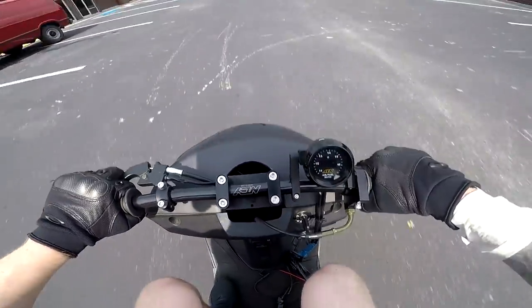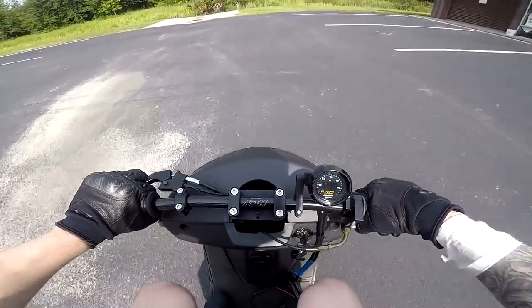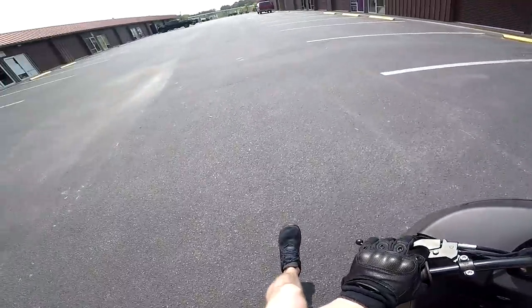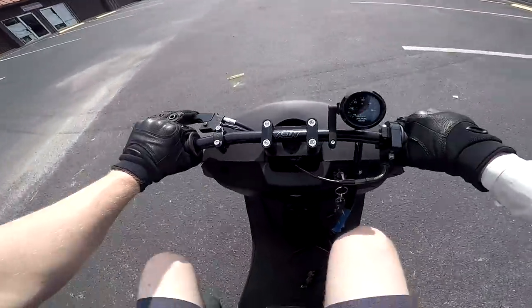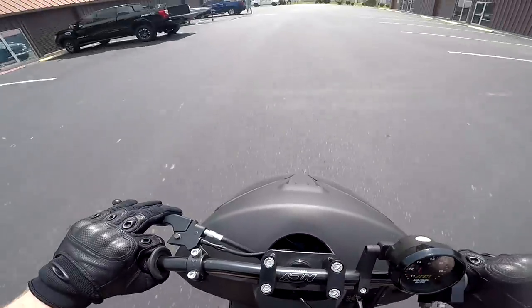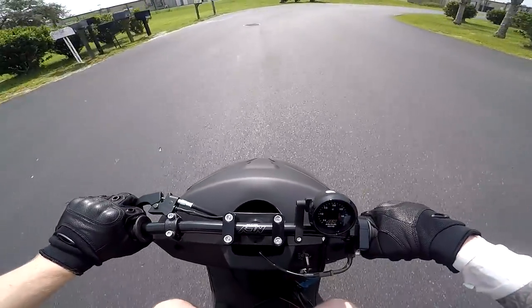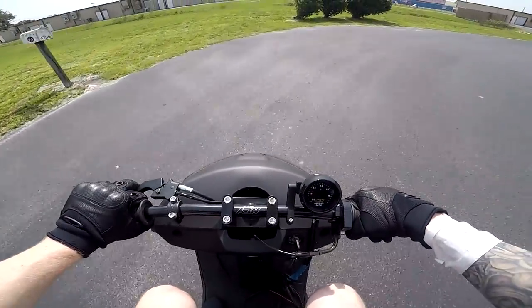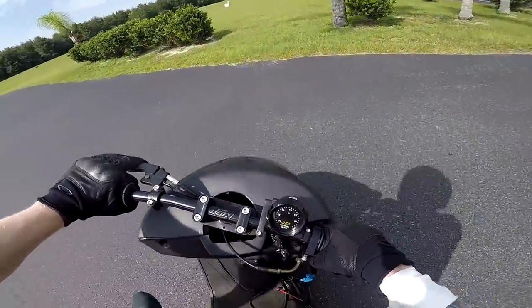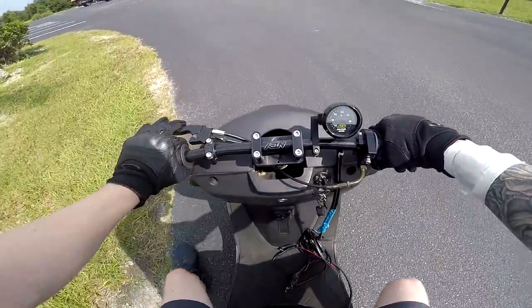Holy crap. Oh, I only got one rear drum brake. That makes it really difficult. Just bearing down to 10.0, so I think I have like a two something main jet in here. We are low. I need to go maybe to like a 200.